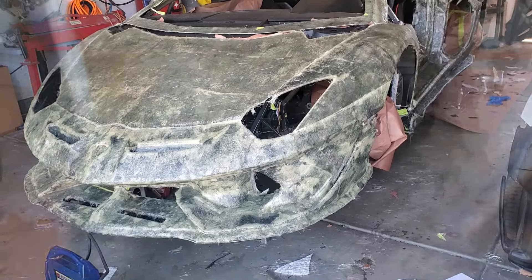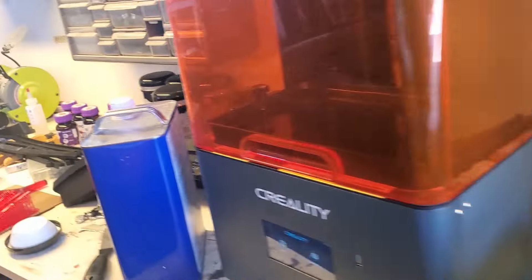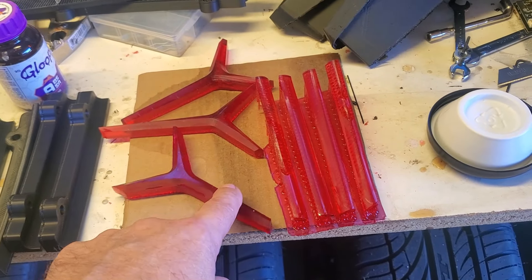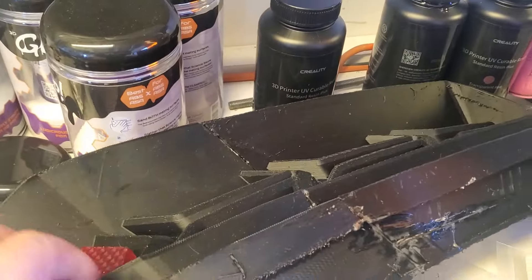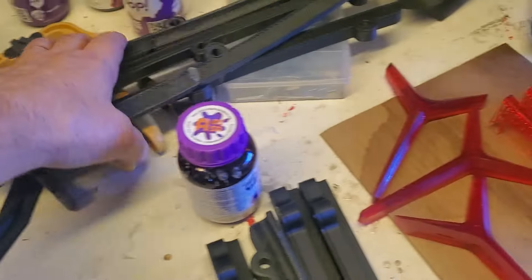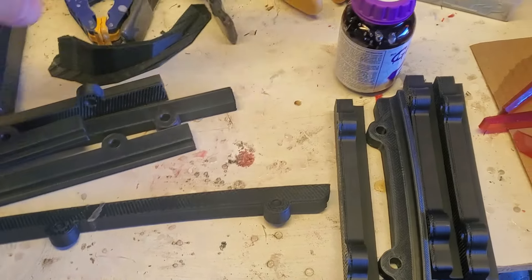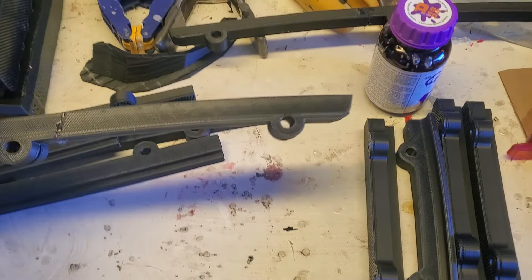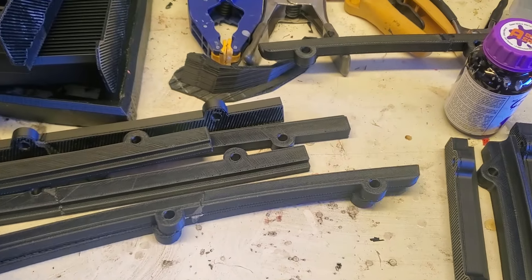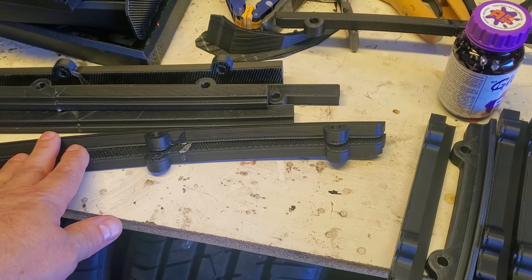Let's get to rolling out those bubbles. I've also been 3D printing — you can see in here we've got a grill going. I actually 3D printed some lenses for the third brake light, and those will have to get glued together. You can obviously see the lenses for the tail lights, which are here. Those all have to be sanded down and bedded in. I also have these pieces here — these are going to be flanges that I'm going to attach to the panels so that we can bolt them all together nicely. That way we don't have weird brackets, and then we'll fiberglass those in to give them a little bit of strength.